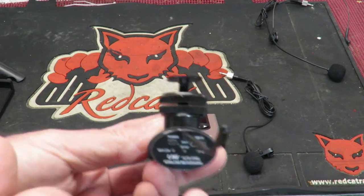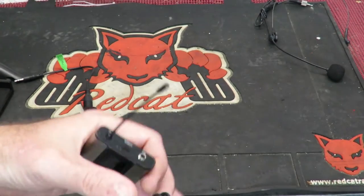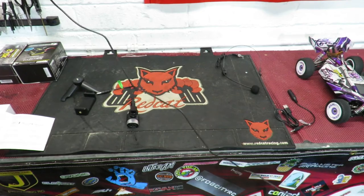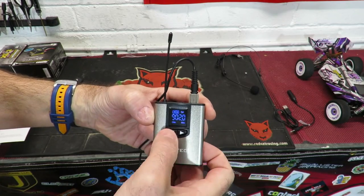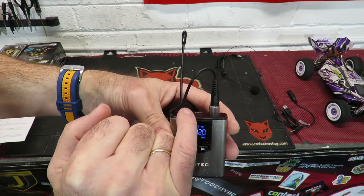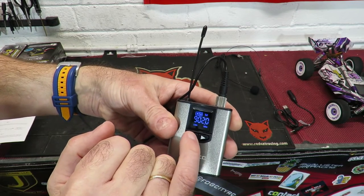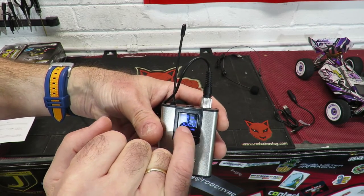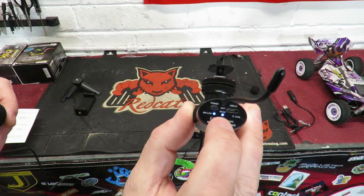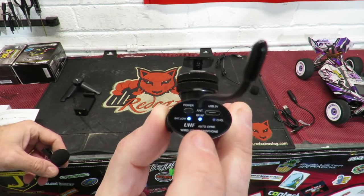The light in the centre lights up when it's paired with the transmitter. The transmitter has an on/off switch on top, a clip on the back, a microphone input, and the microphone actually screws to the top so it won't pull loose. The microphone cord is about four feet long. I've turned it on to test — the volume buttons move up and down using left and right, and there's a battery indicator and signal strength meter on the display. It hops between 25 different channels so very little should interfere with it. When I speak into the microphone the pairing light flashes — 'Mary had a little lamb, its fleece was white as snow' — so the microphone is definitely working.